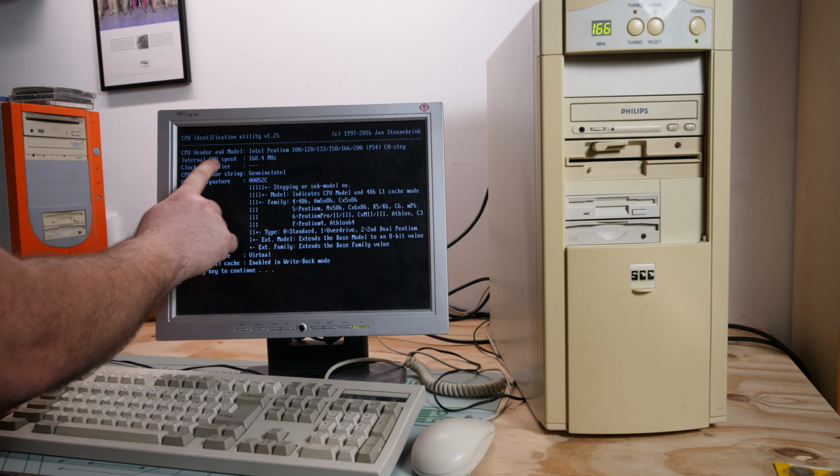If your motherboard doesn't support 3.5 multiplier, try to set it up to 1.5x multiplier, because that is the hidden trick with the 233 MMX. Then it also works like 3.5, but this motherboard already detected that this is 3.5. Save and exit setup. Pentium MMX 233. Oh, and I didn't tell the hard drive is a 2 GB Western Digital.